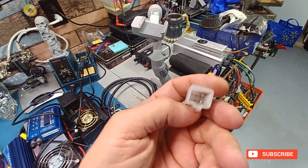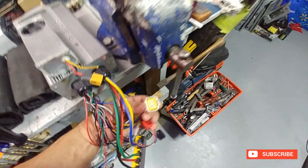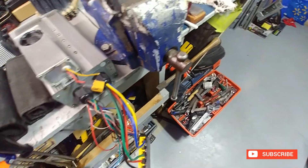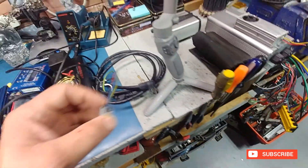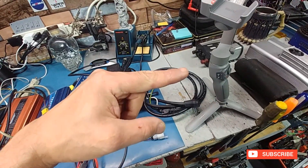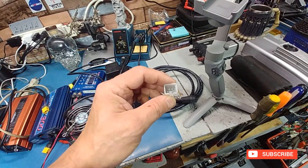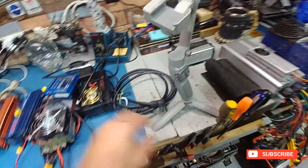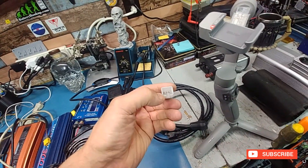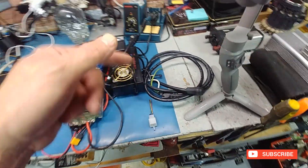What I do is basically take the pin out and shrink wrap the end of it, then just push it right into your hall socket. At least it's open air, so if it gets wet it dries fast — and it also gets rid of this clunky case it comes with. The pin has a barb on the side that sticks out, and when you push it in it locks and you can't get it out. So you take a small jewelry screwdriver, bend that barb straight, and you can just pull it right out — which I'll show you how to do.